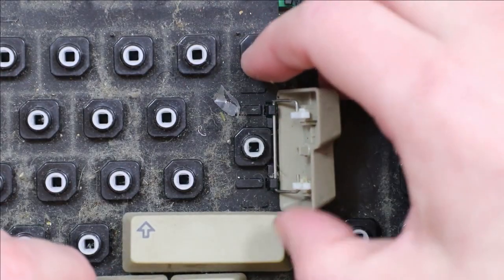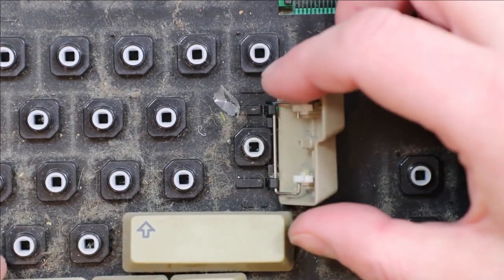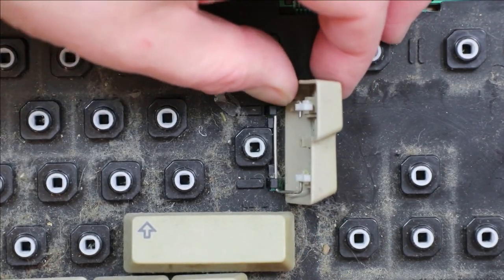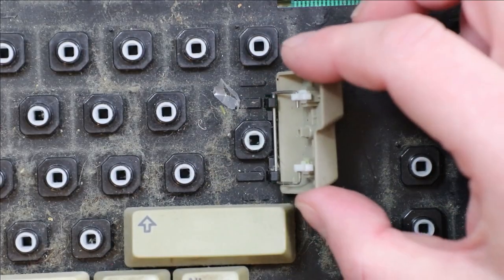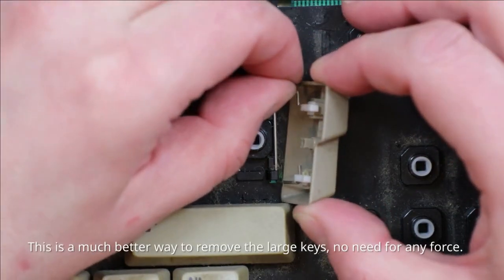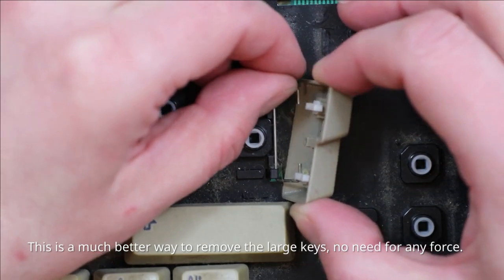Again, you can see here the metal bar on this enter key. You can either push against this to unclip it, which in this case is quite tight. Another way to do these, if you're a bit unsure of how much pressure to put on, is to actually unhook the metal bar from here. Just put a bit of pressure to bend that slightly and then you'll be able to unhook it,